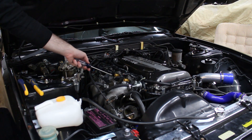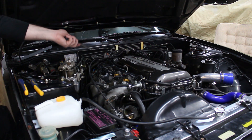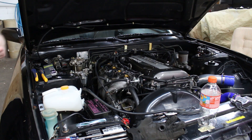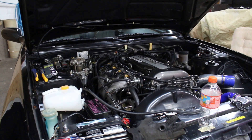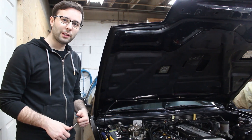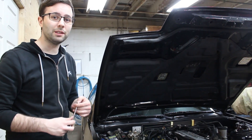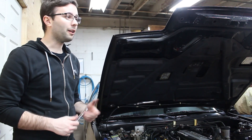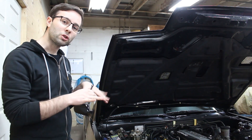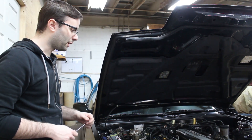You can see now we have two Subaru injectors that aren't connected to anything because the connectors don't work, and then we have two S13 fuel injectors. So you can stop now and turn your car on — two cylinders that run pig rich, two that don't. We are done. The car has no injectors wired up, and as such it doesn't run. Even if the injectors were wired up, we have no tune on the ECU for these 550-something cc injectors. Without a tune, the car would run pig shit — if at all. Because the stock injectors are 370cc and these are 550-something, depending on the impedance you run them at. That'll be tuned probably in my future — we're dealing with a technology ECU retune because I can just tell them what's on the car and they can send it back to me for a couple hundred bucks. We might pull the head off at some point, which means all this has got to come back off anyway.